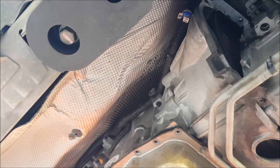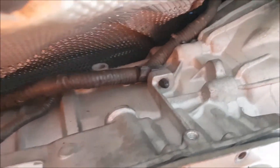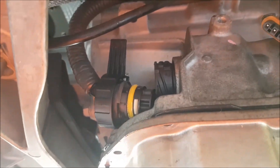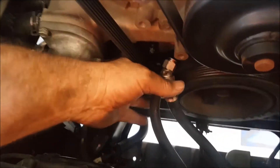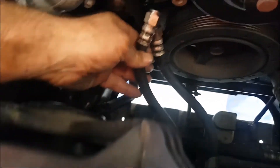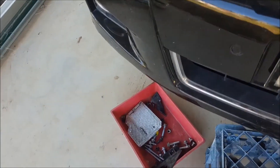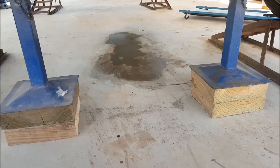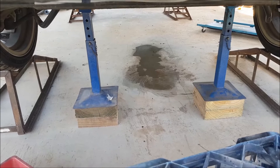Cooling lines - that's going to require a bit of thought. I don't know what I'm going to do with them after I've undone them from this side. I was looking at the cable and it's actually bolted on here with a bracket and a 10mm bolt. These are the cooling pipes where they go into the radiator - I got them out at the expense of making a bloody big mess underneath the car. The amount of oil that came out of those two pipes was incredible, but they're out of the road now.